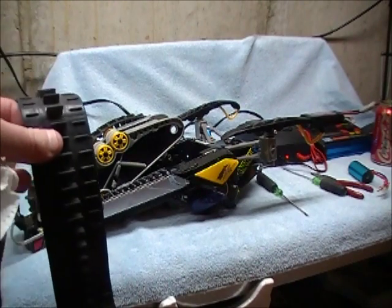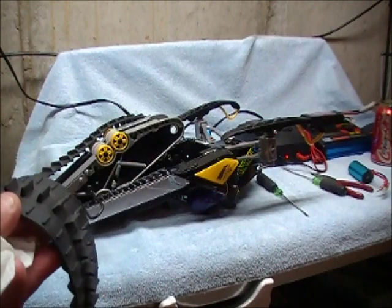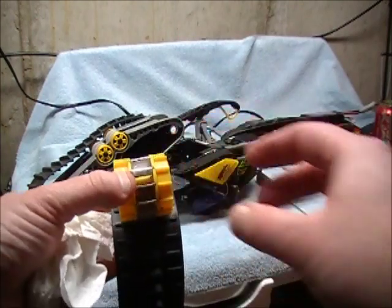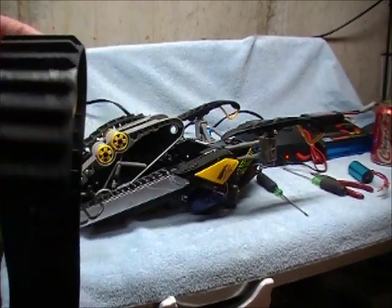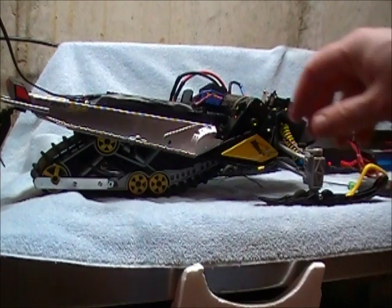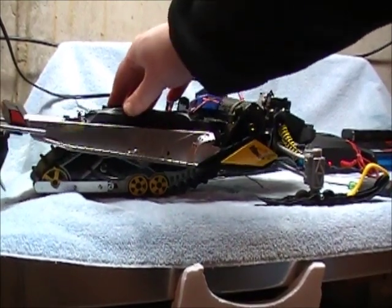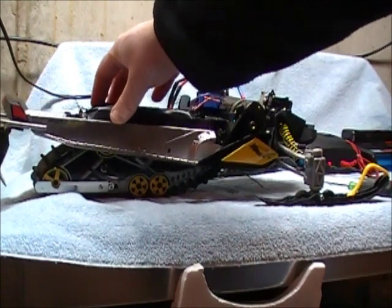Here's a spare track — this one's broken — but you'll see it has these lugs in the middle, and that is what our modified wheel is going to grab onto. Also, one other thing you won't see is I added some oil-filled shocks to the rear. It's just a single shock — like a mono shock — and it gives it pretty good dampening.